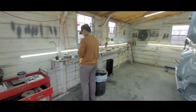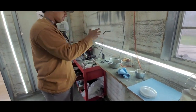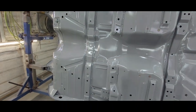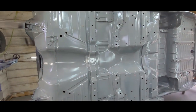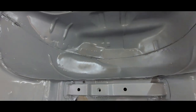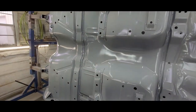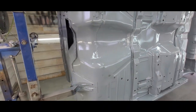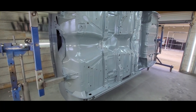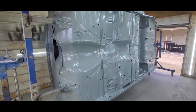What do you think about the SPI epoxy? How hard is it to spray? Just like spray paint. Super easy. There's nothing complicated about it. 1:1. We sprayed about 25 PSI, full fluid, full fan for the most part. When doing the wheel wells, I coned it in to be able to get all the way up in there without it coming right back at you. So coned it in real small, real narrow. But yeah, super easy, man. Transmission tunnel's already notched. This thing already fits on the frame. We already tested that, so moving right along. Bring you guys back once we get some more work.